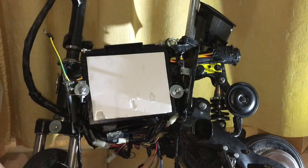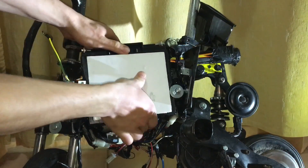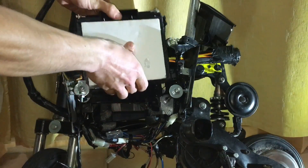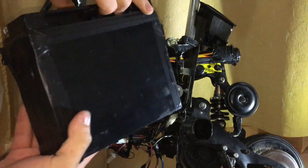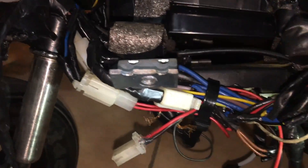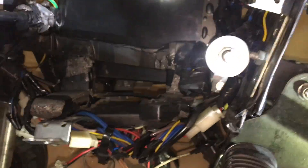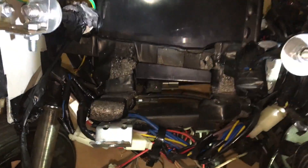Now with the battery free from all the cables around it, I'm going to go ahead and pull it out. So now that we have the battery removed, you can see that we have full access to all the cables as well as the speed controller. I'll begin by disconnecting all the cables that are connected to the speed controller and then I'll remove the speed controller, which is held up just by a couple of zip ties.